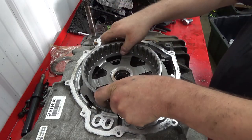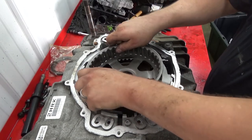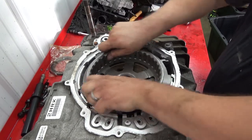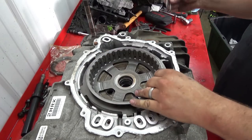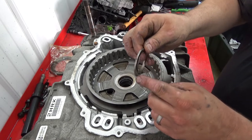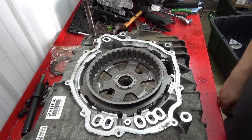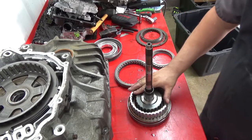Then we have our input sun gear / 2/6 shell. And we'll literally just work it down. Like that, and then you take your thrust bearing, has the raised edges, they go down into the sun gear, like so. All right, now we're gonna assemble the 3/5 reverse and the 4/5/6 clutch hub,